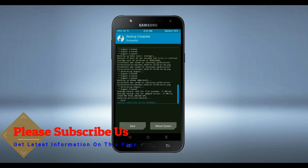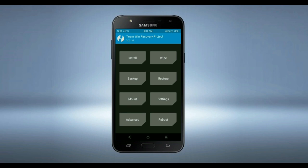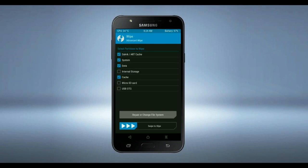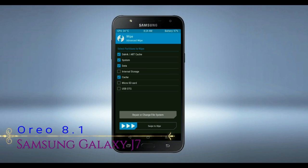Press on back. We will be wiping our temporary data, which will allow us to cleanly install our custom ROM. Select wipe, then select advanced wipe. Select Dalvik/ART cache, system, data, and cache. Swipe right to take action.